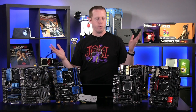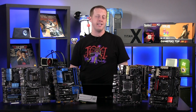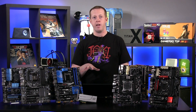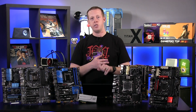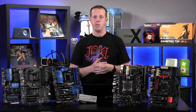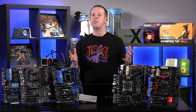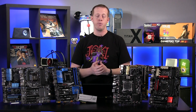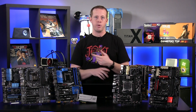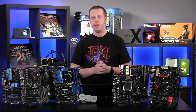We're basically at a point where we can say Intel's claim of only being able to boot in Z97 and X99 boards seems pretty accurate based on our testing. We're still waiting on manufacturers like ASRock and EVGA to release updated BIOS and UEFI versions supporting NVMe boot, but right now we have a handful that we've gotten to function. If you're adding this to another platform and not making it a bootable drive, it looks pretty safe as long as you have a PCI Express 3.0 x4 slot on your platform.